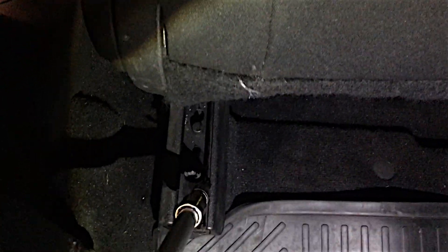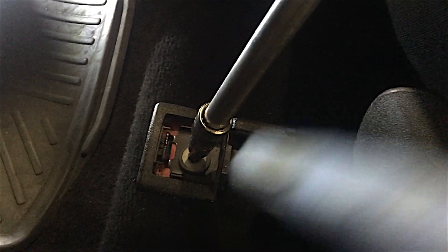I've pushed the passenger front seat forward all the way and you will then see there are two Torx 55 bolts, one either side — you've got to undo them. Now I'm going to push the seat all the way back. There will be a blanking plug either side and these are actually Torx 50s. Fancy having different sized bolts holding the seat. Anyway, I'm going to get these two bolts out.